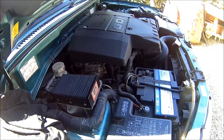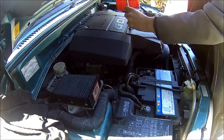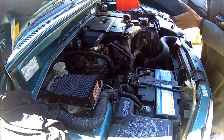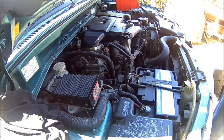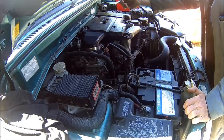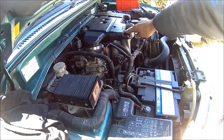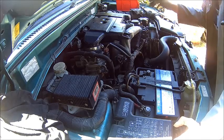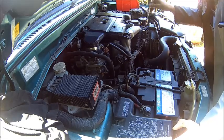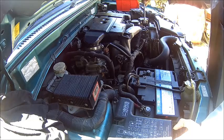It's a little bit of a job because you need to get everything off. Being a Japanese car, it's mostly 10mm, 12 and 14mm. What needs to go off is the whole intake bridge here and this manifold, which is home of the ignition coils and everything. There is a gasket down there — don't start before you have the gasket because it's going to be tight. It's a fancy design because the intake is actually in between the camshafts on the top.